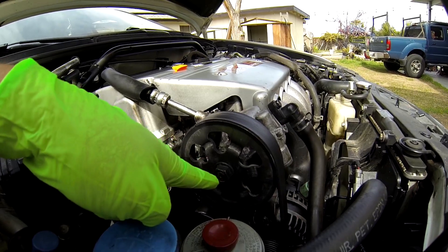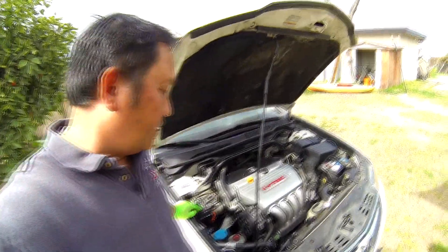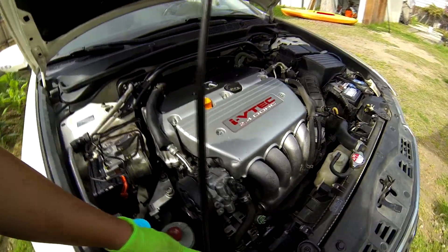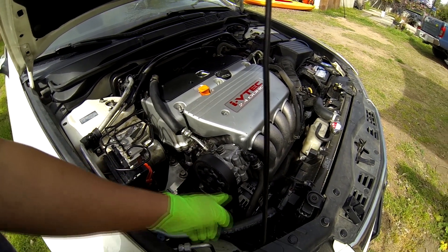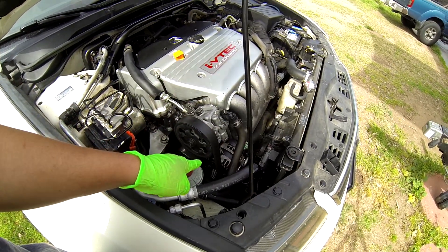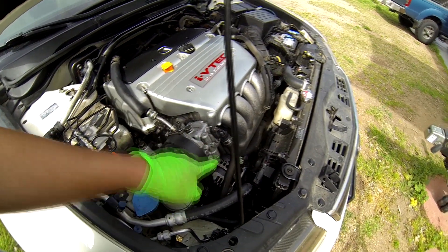The reason is the power steering pump is leaking so much that it killed the alternator. Don't let one thing cause another — if you don't replace the pump it keeps leaking, and it will cause the AC compressor to go bad and the alternator to go bad. The alternator is completely dead because the power steering pump was dripping on it.